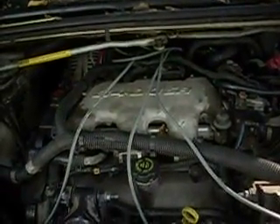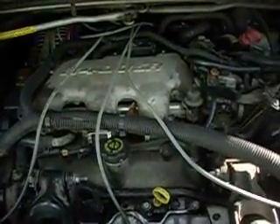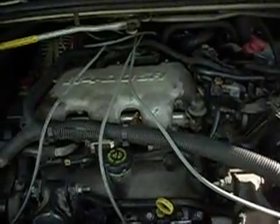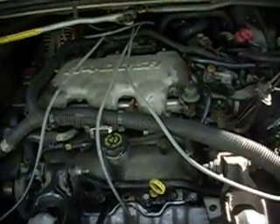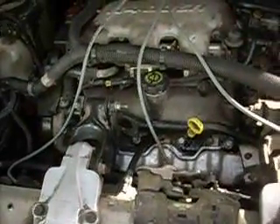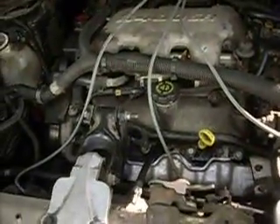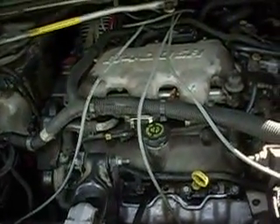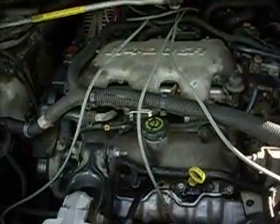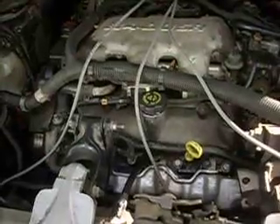I'm going to try to make a long story short because I've actually got a demolition derby to attend tonight. Got it home, tried to get it to start — battery was DOA. Had to take the battery out and charge it. Put that in and it tried to crank over but it would kick back. Turns out the wires for the number two and number four spark plugs were crossed, causing the kickback. Fixed that, got it to start sort of — you'd have to hold it to the floor and it would just sit there and wouldn't rev. It wouldn't even bring the idle up enough to shut the oil pressure light out.